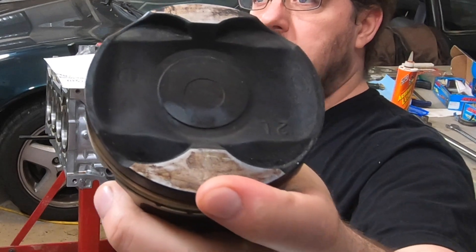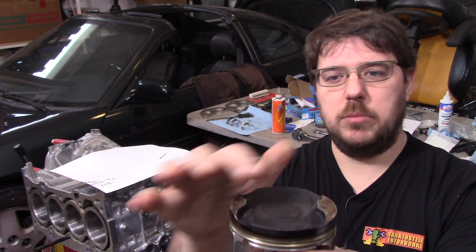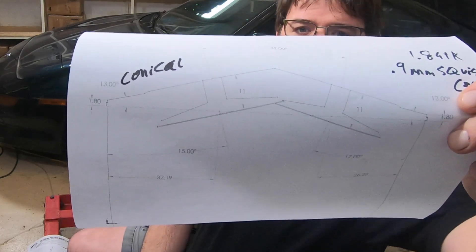Some things were pretty tricky to figure out, especially the squish region right here. I want to get really close to the cylinder head to get good mixing so that I can perhaps back off the timing a little bit. Right now this motor only gets to within 1.9 millimeters of the squish region, and I actually want to cut that down by 1 millimeter to get much more turbulent air inside the combustion chamber. I'm hoping to drop a couple degrees of timing and make the whole motor a little bit safer. It took a whole bunch of time to figure out — is that squish region a cone, a hemisphere, is it different on the intake side vs exhaust side, or does it meet in the middle? Thankfully, it ends up being 13 degrees conical, same on intake and exhaust side, so that's pretty easy to match.